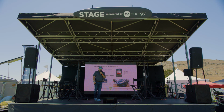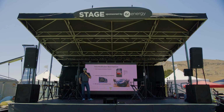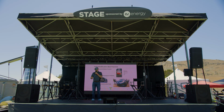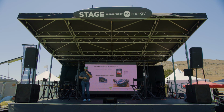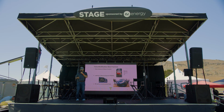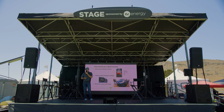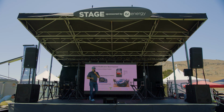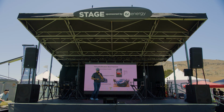Then a couple of best practices. So very typically on Teslas, adding aftermarket carbon fiber accessories is awesome. A lot of people offer that stuff. I would always recommend using wax and grease remover to prep the surfaces. You want them clean. You can't have wax, you can't have polish, anything like that on the surfaces of the parts or the car, or the parts will probably not stick. And also an adhesion promoter. So these are things to help the tape actually activate. But for all Aero parts, you don't want them flying off when you're driving around. You don't want them to come loose.